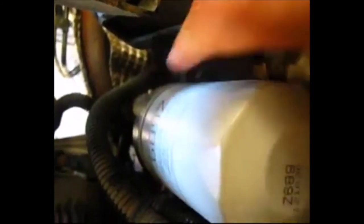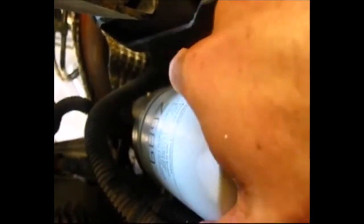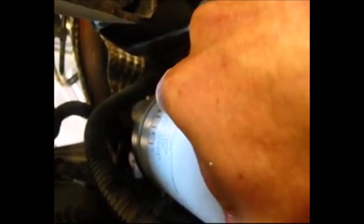Just one more thing before I go — one good idea is to never use a tool to tighten these oil filters up, otherwise you'll never get them off. So always just put it on hand tight, nice and taut, but don't ever use a tool to tighten them up, otherwise you've got to destroy them to get them off. Alright, good luck with your oil change guys.